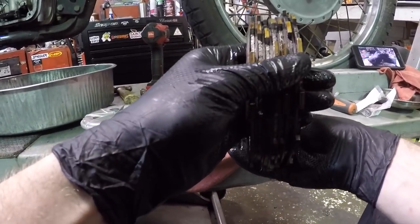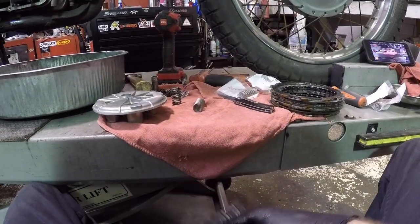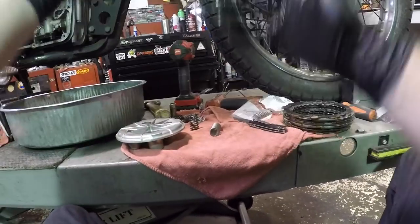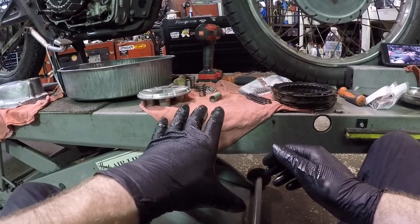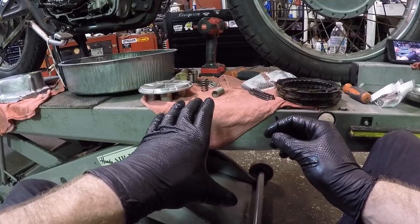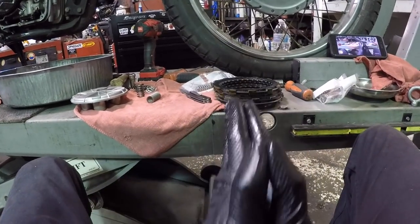Okay? Signs of a smoked clutch are engine RPM increases, but your speed does not increase. A weird funky smell that you've never smelled before, usually, when it's completely smoked out. You can get situations where, let's say your clutch is adjusted perfectly as far as the free play in the cable goes, because you want a little bit of free play in that clutch lever, not just full on all the time. It's gonna be a little bit of movement there where it's not doing anything to the clutch. And you may find that one day it's fine and the next day all that free play is gone because these plates and these clutches have warped and now they're all taking up a little bit of space. So they're dragging and they're constantly slipping.